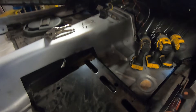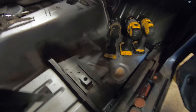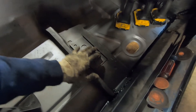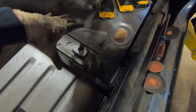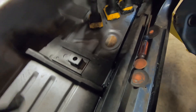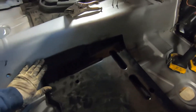We're in the Camaro here, back to work on it. We're going to finally get these seat platform seat risers installed. We have all our seam seal — the floor is all seam sealed — so now we can go ahead and lay these in. As you can see, these were already pre-installed. They weld to the floor and this is the brace for the subframe. Here's the cage nut where the subframe bolt comes up through. These were already pre-installed. It does look like it's twisted a little bit when you lay it in, but we're going to be welding through here, so we have to keep that in mind.